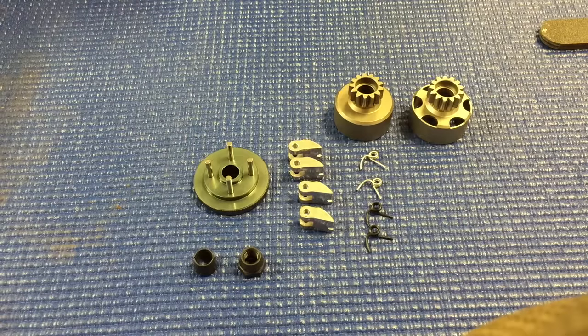If the track's bumpy or low grip, it can be a little bit aggressive and hard to drive. With the four-shoe clutch, it engages a little bit earlier and smoother, and it's also more tunable by having four shoes with different springs. You can also offset between the hard and soft shoes as mentioned earlier. It's very tunable, provides smoother power, and will also help increase run time due to not having so much stall before the clutch is engaged.